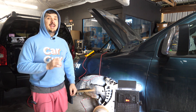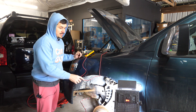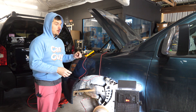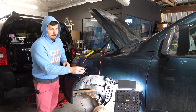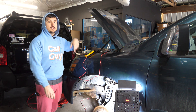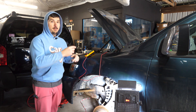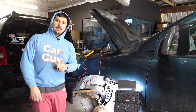If you don't have a scanner that scans these, it's a bit of a pain. But the easiest thing to do on these Titans is that the front sensors are actually interchangeable left and right. So you can take your bad sensor — or what you think is your bad sensor — throw it on the other side, swap it, and see if the error follows that change. For instance, I'm getting a front left error. If I swap them and drive it and I get a front right error, then you know it's the sensor because that's the only thing you changed.